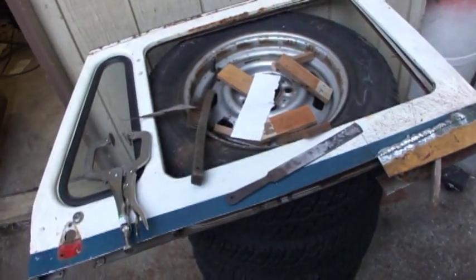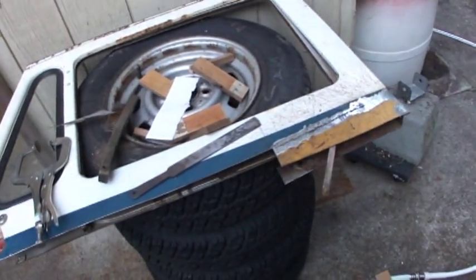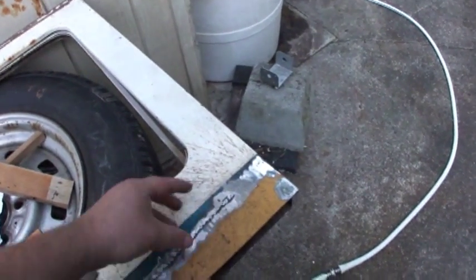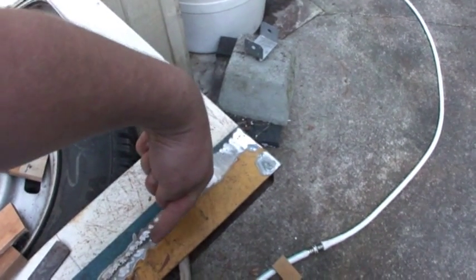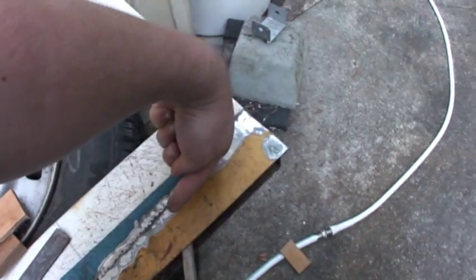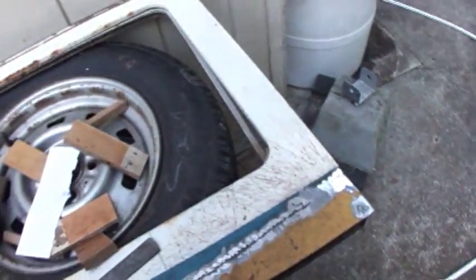As you can see, the passenger door comes down farther for where it's going to slide together. It's actually going to have a piece of metal — probably a bolt — that goes into the bottom part of the door so it locks the two pieces together. That's why I haven't finished welding this one up yet, because I plan on fabricating that. It gives me a couple inches of ability to work with.